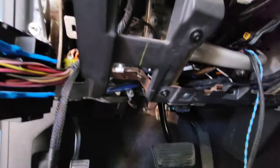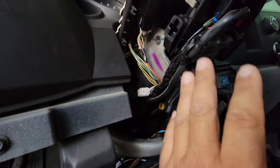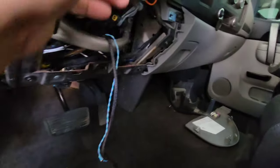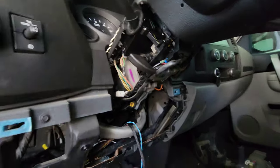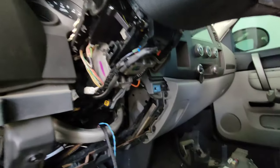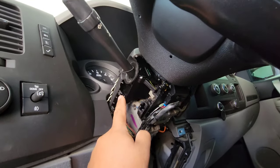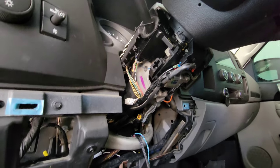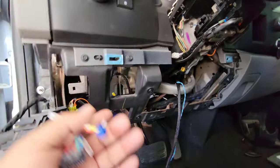On this section, it's really easy — you really have one 10mm and then two Phillips right here. The bottom half of the column: first you take this little tilt piece off — you literally just put a pry tool behind it and it pops out. Then this bottom half piece just unclips; you can see the clips on both sides. There's no screw, nothing holding it in — it just unclips.